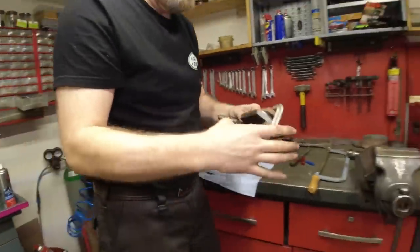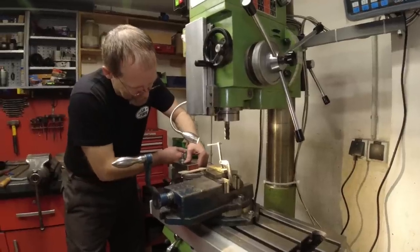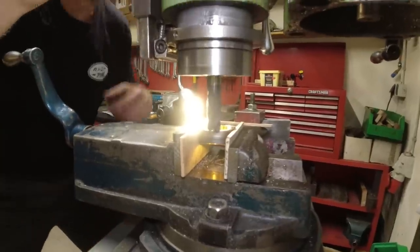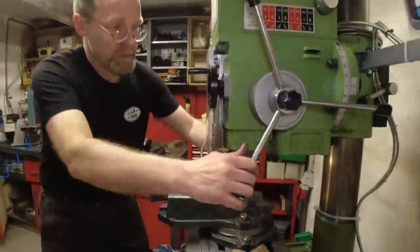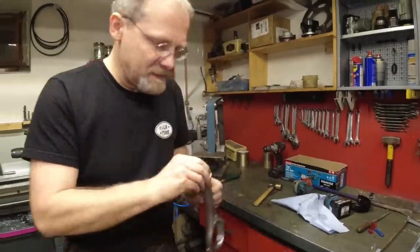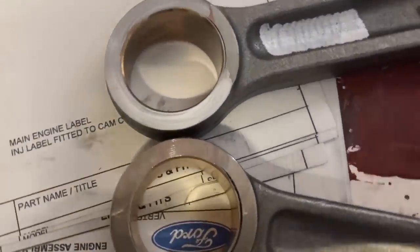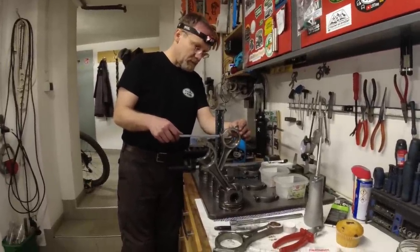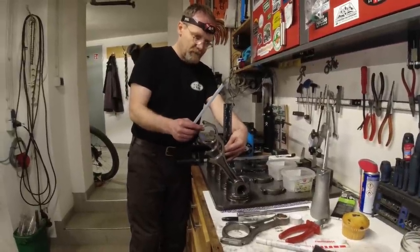Now I've got my reference surface picked up. Put this back into my vise. We wouldn't have this YouTube channel if things weren't like they are. I clamp this down and open it up again. Kiss it — and done. Let's see if it fits. I'm going to give it a little scrape with our Toyota scraper. Here is the finished machined end of my number four connecting rod. I think we've got by far enough range of motion — this is about center, and we still have ways to go on either side. We have enough freedom.